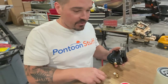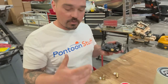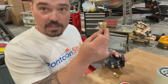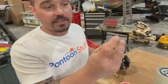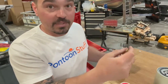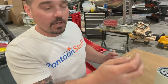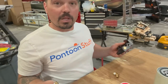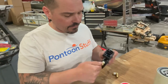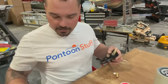For our other pieces, you could do several types. You could do a straight barb fitting if your line is going to go straight out to its destination. In this case, I'm coming up to the fuel tank, so I'm going to use a 90-degree elbow. On this motor, it's three-eighths inch diameter inner diameter hosing. We're running this fuel line about 10 feet, so I want to make sure I have plenty of fuel flow. You can always look up your manufacturer's specs on how big a fuel line you need and how much you're able to run. This is just going to thread in, and I'll tighten it and orient it so it's pointed down.